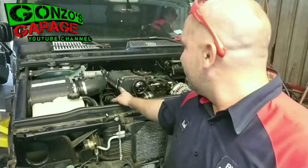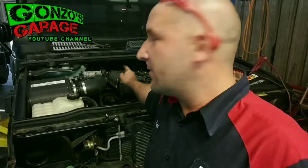We looked back over to the correct side and the injector plug — where that harness branches off to go to the throttle body — runs right to that injector. When it was pulled up to plug into the throttle body, it wasn't clipped on the injector all the way. Usually number one is on that side, but because it's supercharged, the cylinders are on different sides — they had to move number one over because that's where the valve cover was going to go.